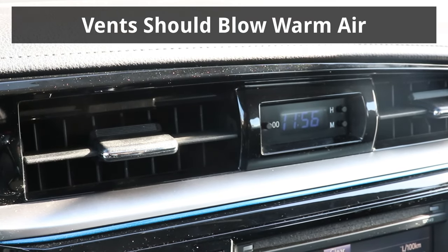The same amount of coolant that drained out should have gone back in by now, and if there's a noticeable difference, then there's air still trapped in the system and it should be bled out before driving the car. A small amount of air will bleed out on its own over the next few warm-up cycles; however, a large amount of air should be bled out before driving, because it can cause hot spots and overheating. Now I'll let the engine cool down completely again — as it cools down, coolant will shrink and the level in the reservoir tank will go down. Once it has cooled down completely, I'll make sure the reservoir level is still at the full mark, and I'll check under the car to make sure there are no leaks.